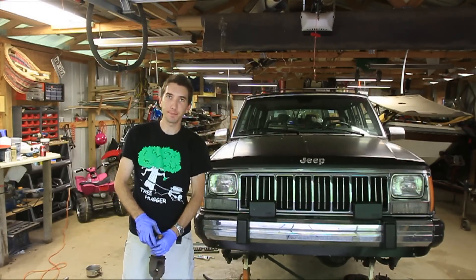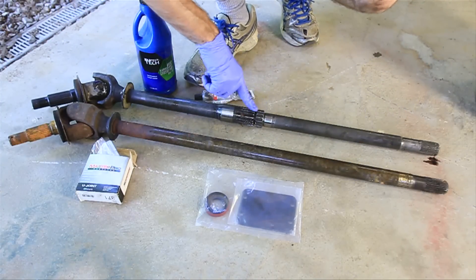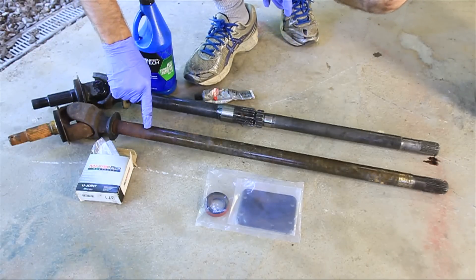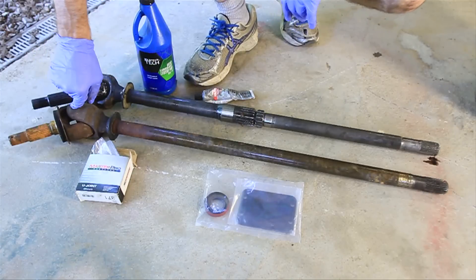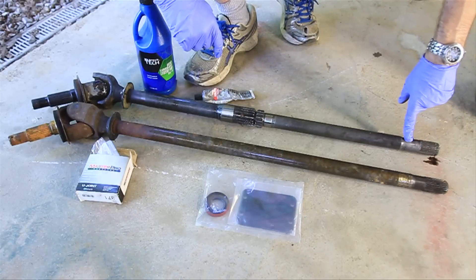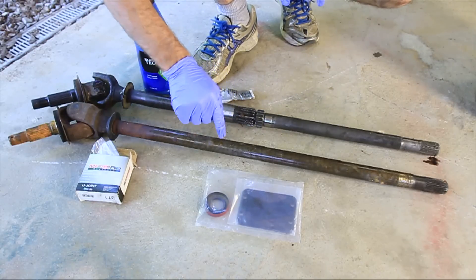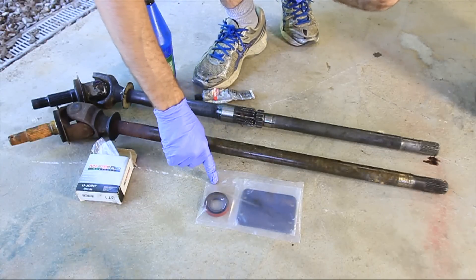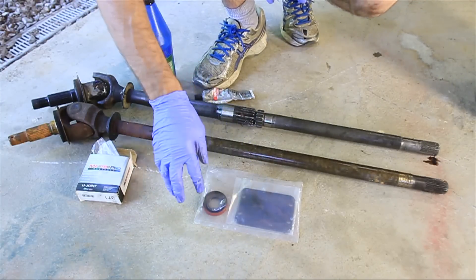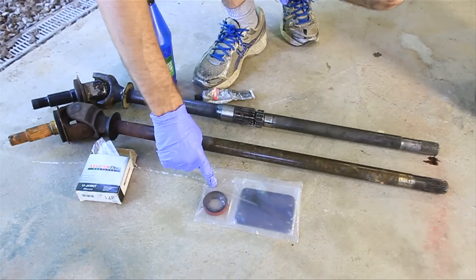Alright, let's get started. So here's both the shafts. This is the older one that splits in two — it has the central axle disconnect right here. And this is the new shaft, the one-piece that we're upgrading with. You want to make sure you get this out of a '95 or later Cherokee, because the '95 and later has the larger U-joints. Now the new axle shaft has a seal down here by the carrier, and the older shaft does not — its seal is up here on this larger area. As you can tell, the seal from that is not going to fit on the newer shaft, so you're going to want to get this kit. The kit comes with the new seal which fits down here by the carrier, and it also comes with this block-off plate. If you don't want to get the kit you can just get the seal and make your own block-off plate, but the whole kit is only $18 — I'll leave the part number for that in the description.